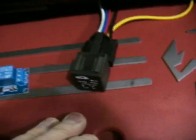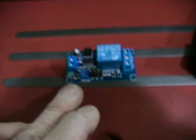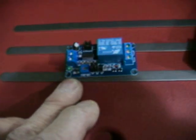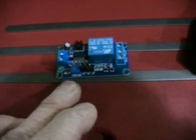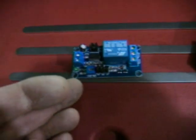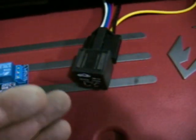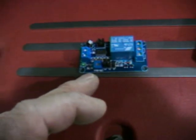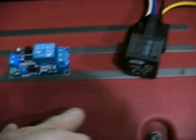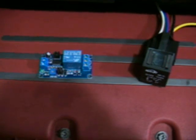So the sequence of events: when the car shuts off, it applies 12 volts to the off-delay relay, which starts the pump. The pump runs for a set amount of time — probably a minute or so — then times out and shuts the pump off. It stays off until you turn the car back on, which opens the relay, drops the voltage, and resets everything. When you shut the car off again, it starts the pump up, runs it for a minute, and shuts off. I'll have a schematic diagram attached to show the relay and wiring.